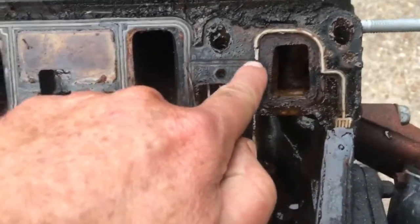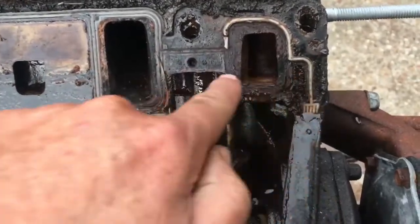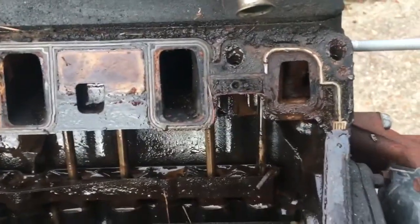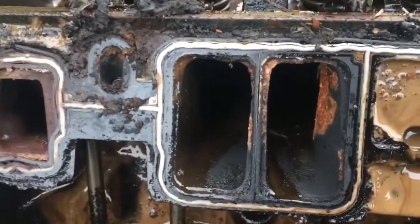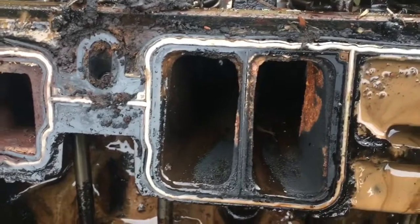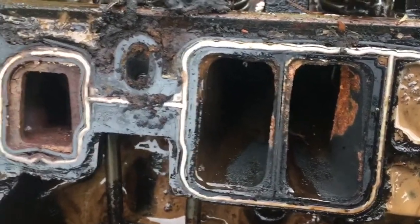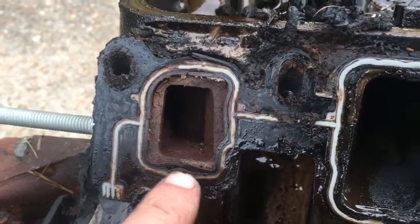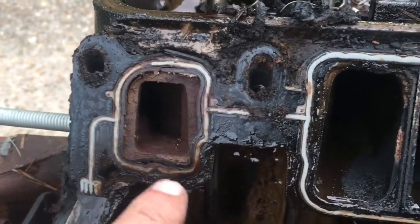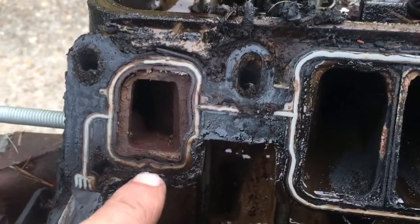You see the remnants of the intake gasket right here. That gasket is basically disintegrated — you can see it right here. See how the gaskets are wavy and not really holding their shape? The Dex Cool eats the plastic. There's a really good spot right there. I just pulled this intake off; it's probably original, and Dex Cool is what does this — it disintegrates the plastic.